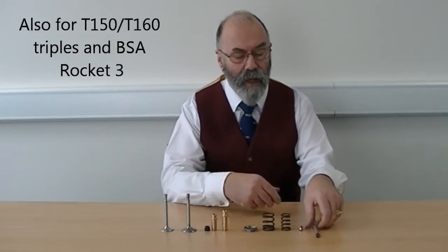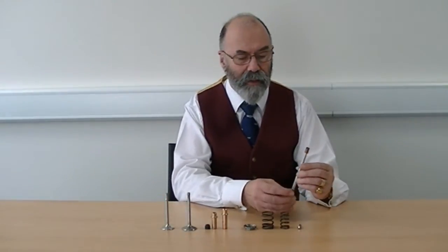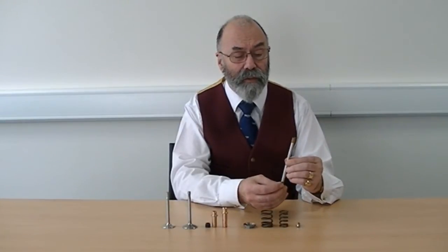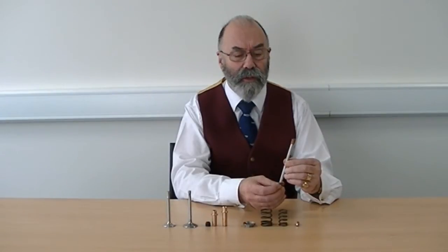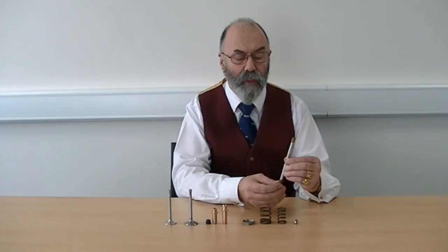The classic Triumph pushrod engine. It's one of our push rods, all parts made in England. You can see the tapered shape. This gives an extra stiffness based on the works Thruxton racers that is particularly so important when race cams are used that are trying to open the valve quickly.